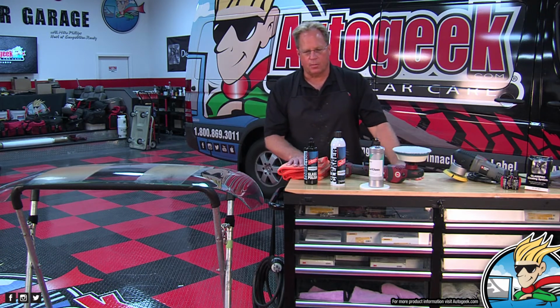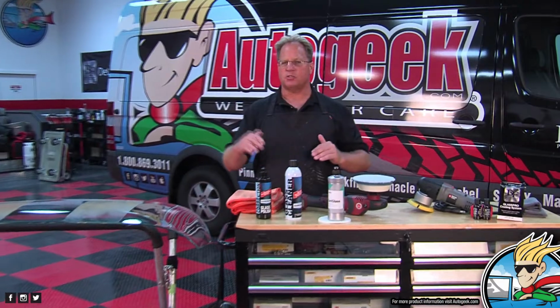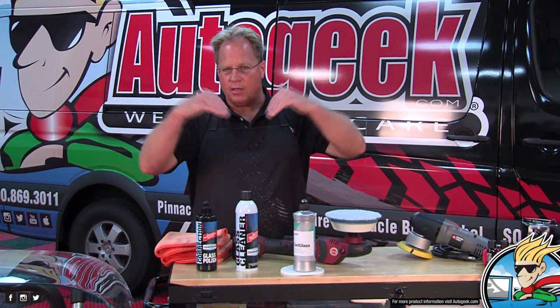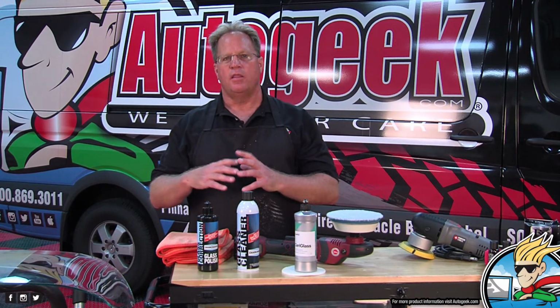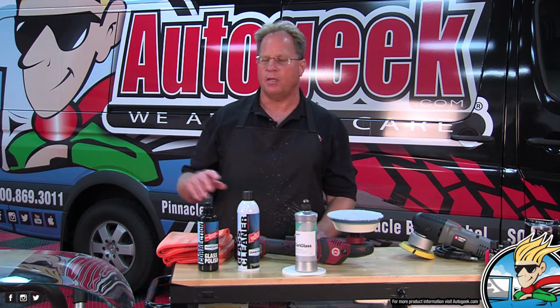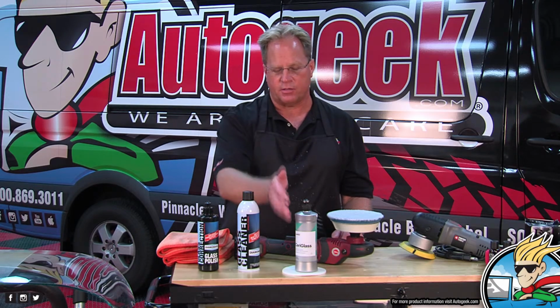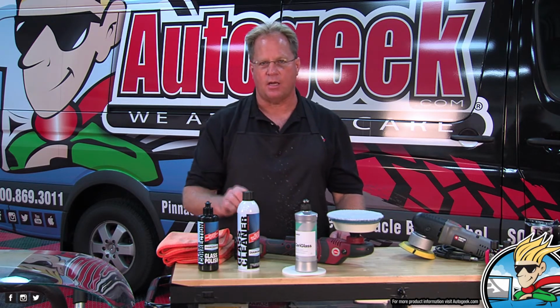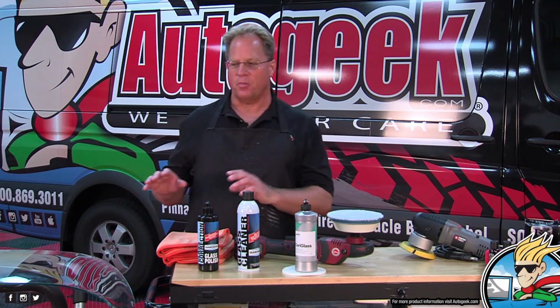Let me give a little background on this. This is topical glass polishing. There are two kinds of glass polishing. There's subsurface, which deals with wiper marks, scratches, pits, and tiny defects in the glass. And then this is topical, for films, water spots, and any kind of gunk that builds up on the glass. The difference is that this is a lot easier and doesn't take a complicated abrasive technology, whereas subsurface requires a product that contains cerium oxide, a rare earth mineral. You really can't do it with anything else, even though all the comments seem to imply that you can. I've never had anybody show me they could using clear coat paint compounds, but I'll let that one go. Anyway, we're going to do a topical polishing.